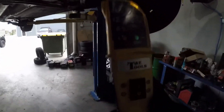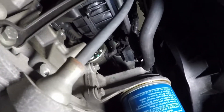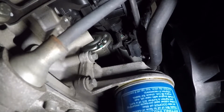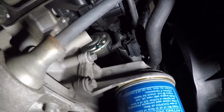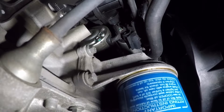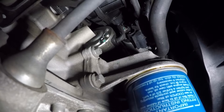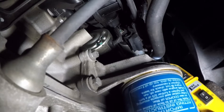What we're going to do is check the body for an earth, check the main power to make sure it's got 12 volts, and then if that's good we'll go back up and rig up a wire on the trigger wire and crank the car to make sure we've got 12 volts there. If that's all good, we know this is more than likely going to need a starter motor. Bear in mind that sometimes an engine might seize, and obviously a starter motor is never going to work if it can't move the engine. So if you're unsure, check all the starter motor wires and if they all come up good, just grab a socket on the crank pulley and turn the engine - if you can turn it, you know it's not seized.